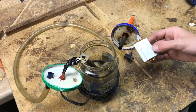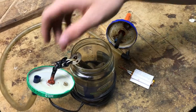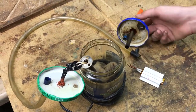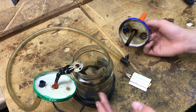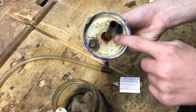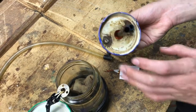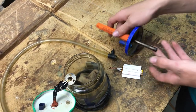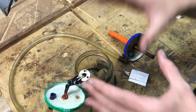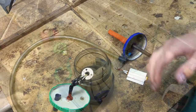The coffee pot heater did not get hot enough, so we ended up wiring an old soldering iron, which always seems to work. We had to disassemble it and take the handle off. But if you have one that has a plastic handle where that plastic flare can glue on with no metal pieces touching the lid, that would be best — because you can't glue a metal piece onto the lid since all that heat will wick through it and burn up all the plastic.